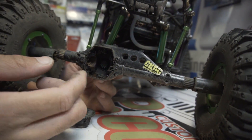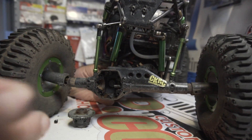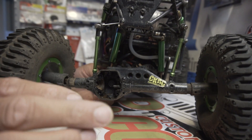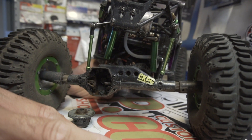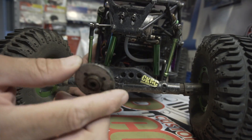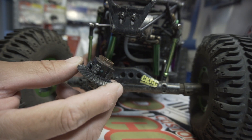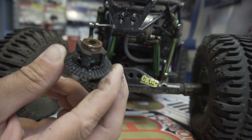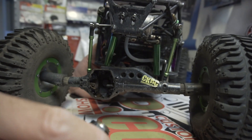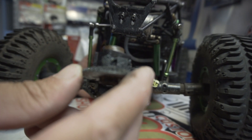Clearly there is a lack of maintenance. Something a lot of people don't know is that this is factory stock as far as all the gearing goes — it has a factory transmission with factory stock gearing. But as you can see, this is not a hardened steel ring and pinion gear, just the standard setup. This has been in here for going on four or five years now and you can see it's all rusted up. There are some issues — we might have to replace a couple of bearings — and clearly the teeth are worn sharp.